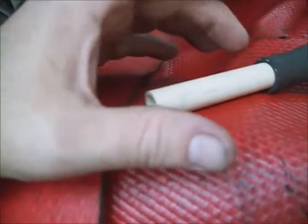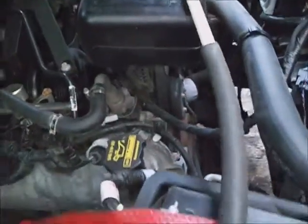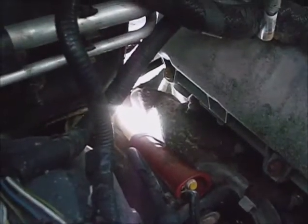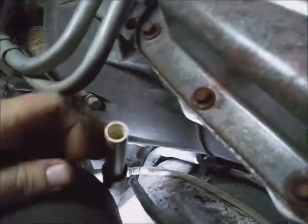I'm on the passenger side corner of the truck. I need to get to the fill hole between the engine block and the oxygen sensor down there on the transmission. I'm using a piece of half-inch CPVC water line with an extension and a piece of 5/8-inch heater hose that's clean inside — about 3 and a half to 4 feet of straight pipe — to fish around behind the oxygen sensor and down into that hole.